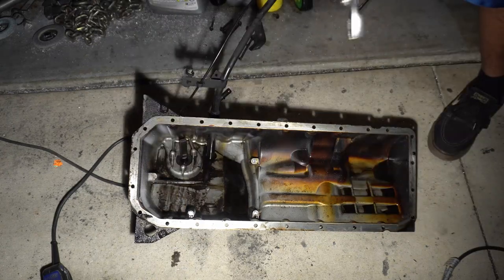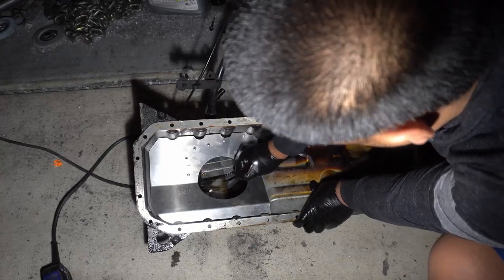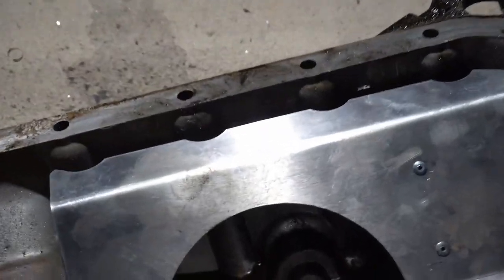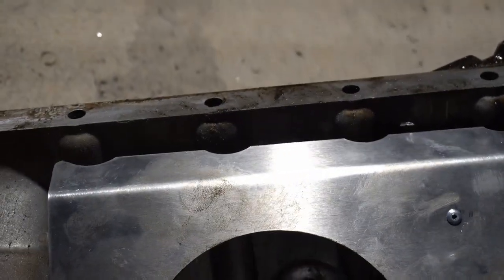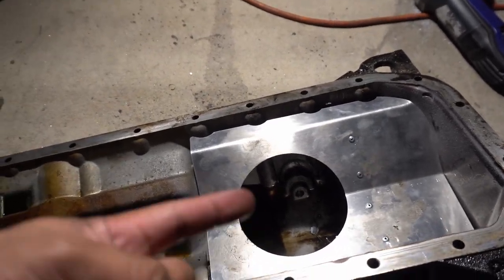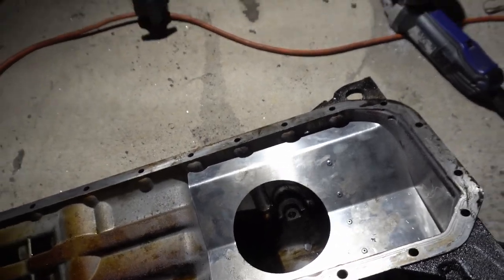Out with the old baffle. The new Achilles baffle doesn't seem to leave much room at the top unlike the stock baffle, so I'm probably going to have the oil return bung sit below the baffle — which ideally I don't want, but I'll have to deal with it. Since I'm running a bottom mount turbo, my options are very limited. Worst case scenario I'll have to mock up an oil scavenge pump, which is no big deal.